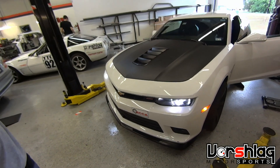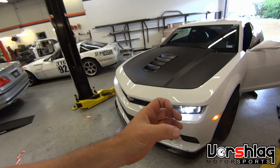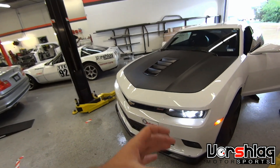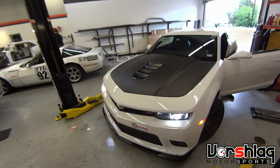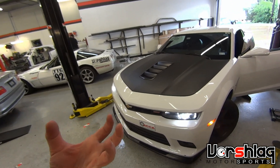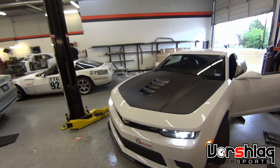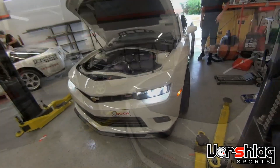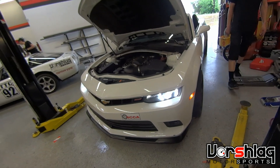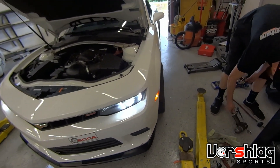On the OEM spring, we have to check that you can't move it so far that the spring runs into that dent in the tower. He's steering it left and right for a walk, and it's not making any popping noises, which means the spring is not hitting the tower — which is good. Sounds good, I don't hear it. So this is stock suspension and the alignment rack shows three and a half degrees, so it definitely works pretty competitively.